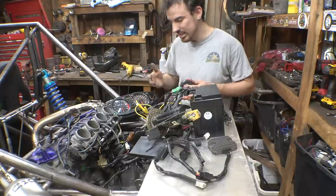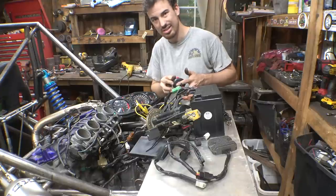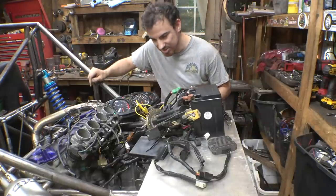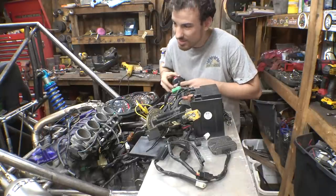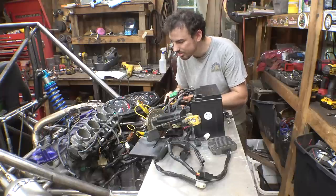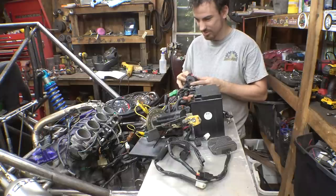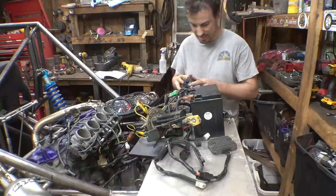You can definitely hear a relay doing something when I turn the engine to its on position. That is normally when the fuel pump primes, and the fuel pump isn't, but at least the solenoid is working. Okay, let's see if it's getting a spark. I'm pretty sure it's these two. All right, clutch should be bypassed. FI light just turned off. Fuel pump still isn't priming, but a relay is doing something.